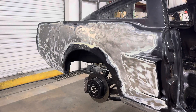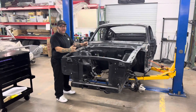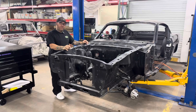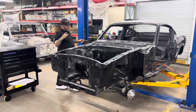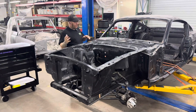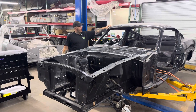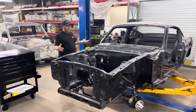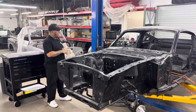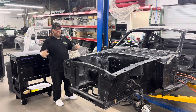The Wayman Mustang here — this poor thing again, there's more video on this. This is the one that had filler and the quarter panel on the right side that it was made out of. What we're doing now is a full deconstruction of this car. We're doing a Roadster Shop chassis on this, a brand new Ford Performance Coyote motor, and a transmission from Bowler — a 6-speed, one of the carbon units. A lot of this stuff is going to go away — the towers, all the suspension and steering. The customer has somebody who wants it. We're going to sandblast the body after we do some stripping on the roof, see what we have left. We already know we're replacing a great deal of this car — the floors, wheel tubs — all custom fit to that RS chassis.